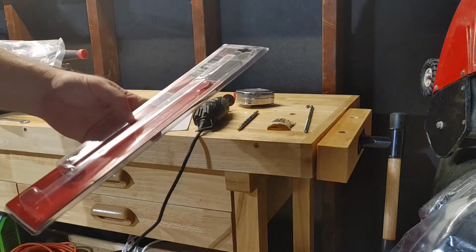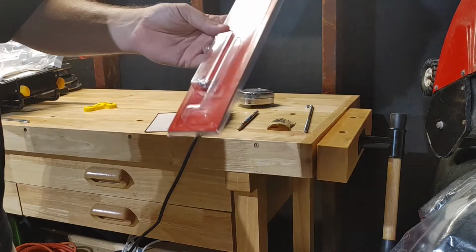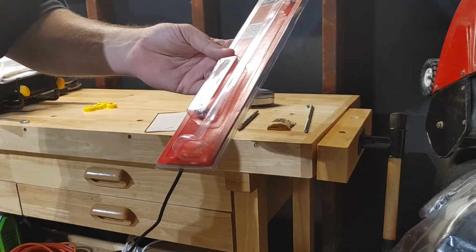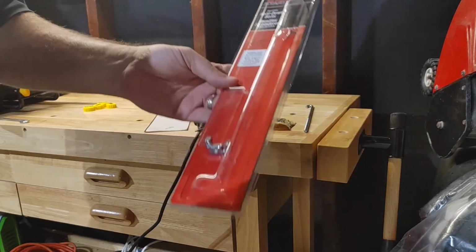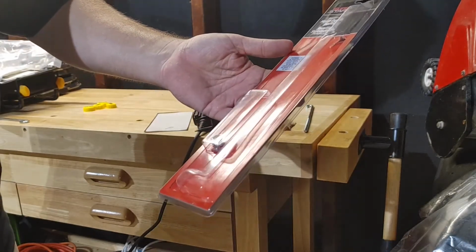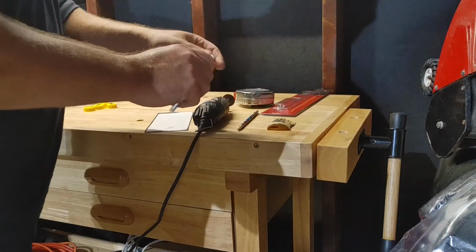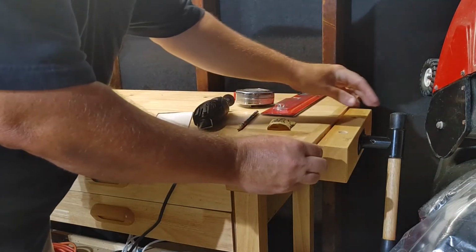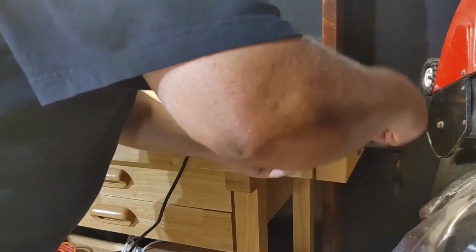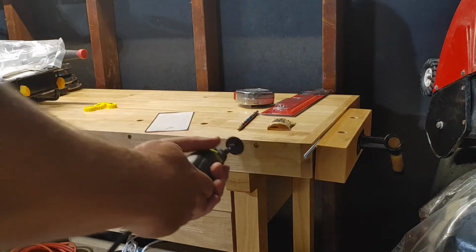And buy other hold down bolts. So I had to get some 10-inch ones because the new battery hold down, the welded tubing on the top, raised the level where the bolts were, so 8 7/8 were not enough. So I had to go, struck out at NAPA, returned the other ones, stopped at O'Reilly's and got these 10-inch ones, and now I have to trim them. So I got them fitted. I have them marked. I need to go a couple of threads below where my marking is.